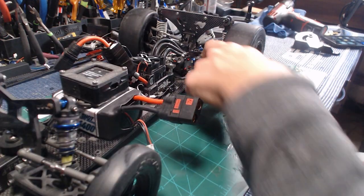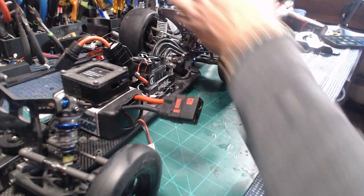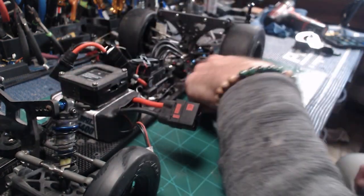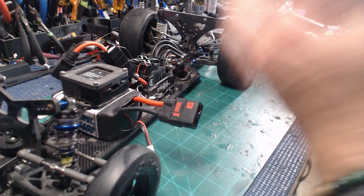Now there are some do's and don'ts. Most people are going to immediately think that if they want to change their ride height, they'll just start turning in their shocks or put in some spacers and limiters. But the biggest thing you have to watch out for is the transmission. If we look at the dog bones in the back corner, they've got just a slight little angle on them when driving. When you lower the shock towers to get this down about five millimeters, the angle of attack increases a lot, creating so much more resistance and stress on your powertrain and transmission that it's really not going to benefit you at all.